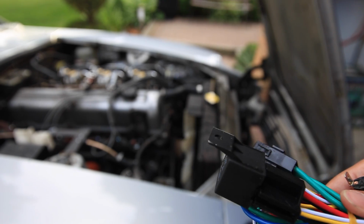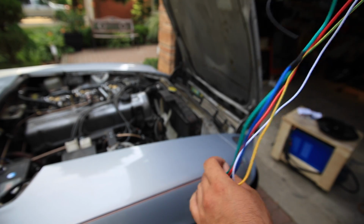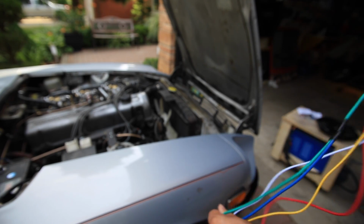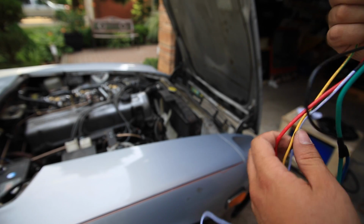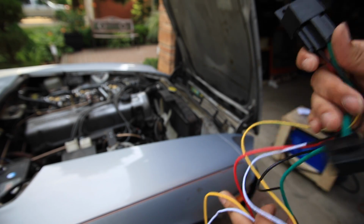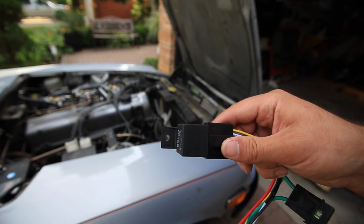Okay, next order of business. The relay and wiring harness. So you've got a relay, you've got a fuse. Power, main power cables, these are the hots that go to the fans. There's going to be a common negative somewhere there, and these two thinner cables are going to go to the thermostat probe. You need to account for all of this wiring when installing the whole relay assembly.